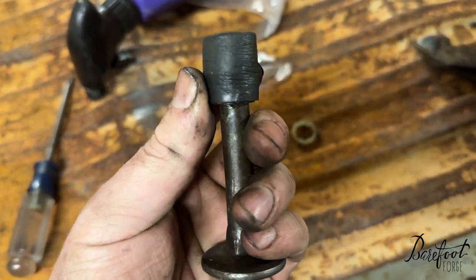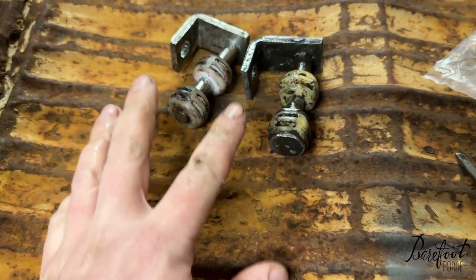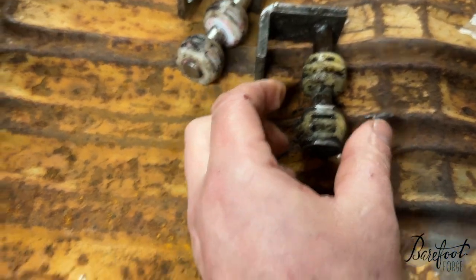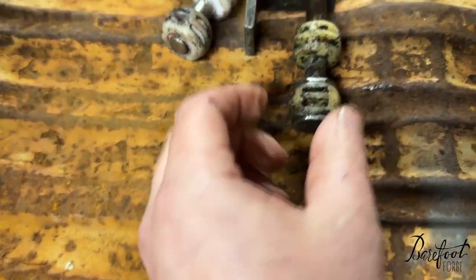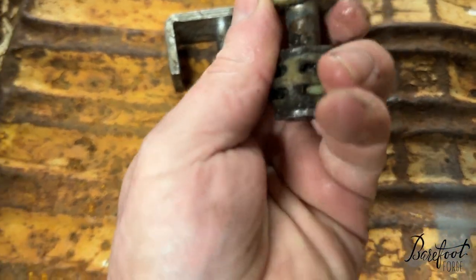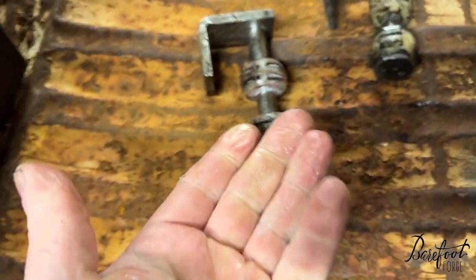Whatever this rubber compound is, I'm sure the fine people of Poland did a great job manufacturing this with just a drill and some sandpaper - that's what it looks like. The problem back here is that this guy we took out is so ruined - it's totally square in this direction. Looks like to deal with sloppy shifting they squeezed the metal tabs in, so now this guy doesn't fit. I have to either spread that or reuse this square piece. Everything on this car is completely totaled. I think I got the shifter shifting - I just bent it open because I think they bent it closed. It's way too tight but it'll wear in. Lots of grease - it's together. It feels like all the gears are there but you don't know until you drive it.